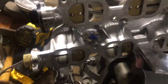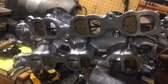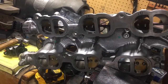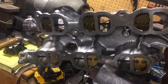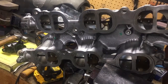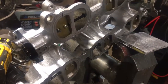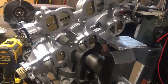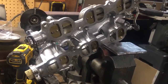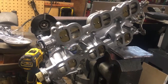It's all about volumetric efficiency. It changes these butterfly valves and these intake runner ports based on your throttle position. If you're at wide open throttle, it would probably be like that. It adjusts via the computer and this sensor right here — that's your position sensor — which lets the computer know what position these things are in. It moves that to get the most out of the air-fuel ratio going into your engine. That's how it works, as I understand it.